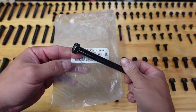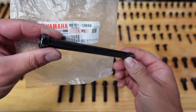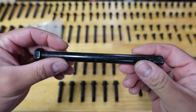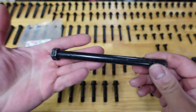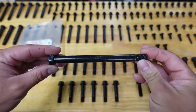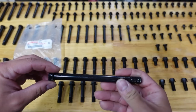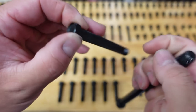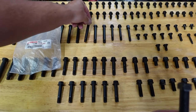I'm no master when it comes to electroplating, but I do know that with pretty much any kind of coating or plating, prep is where it matters. This is a brand new bolt straight from Yamaha — this is the coating you'll get from the factory. If you have an older machine, it's kind of like an olive drab greenish color, but this is actual black zinc from the Yamaha factory. You can see there are some mild imperfections. When you hang it the way James does and individually vapor blast each bolt, you get a more consistent finish. Looking at the tops, this one's just a little bit nicer.